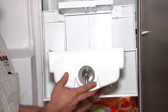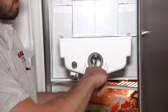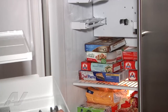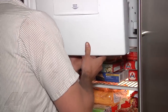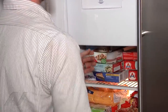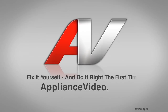That's going to complete the repair. Before you slide the ice bucket back in, the auger itself is going to be kind of forked, so you want to set them up opposite one another — if your auger is facing this way, put the bucket up and down so you can see how the fork is oriented. Set them up opposite and you should feel the ice bin slide all the way in. Thank you for watching another quality video from ApplianceVideo.com.